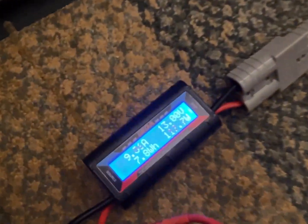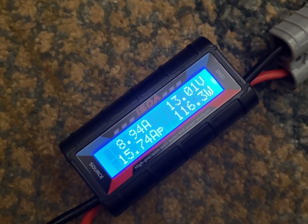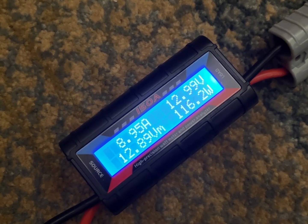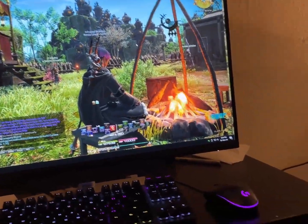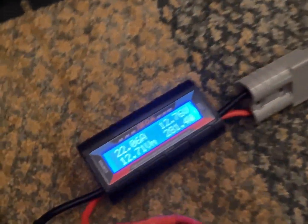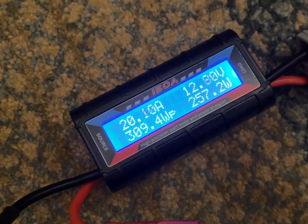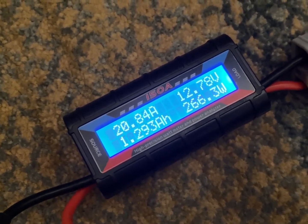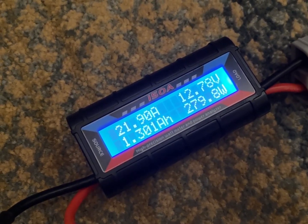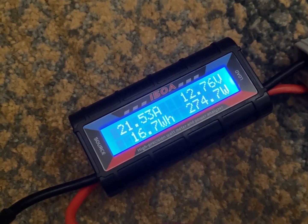1080p video playing full screen is about 120 watts. It actually gets a little bit better wattage now. While gaming, it's only pulling around 280 watts, whereas before it was doing 330 or something like that. So cutting out the television and sound system definitely helped.